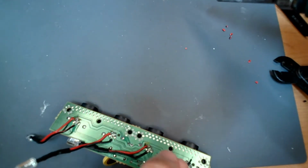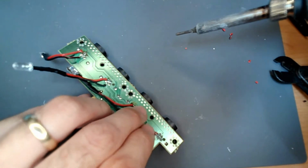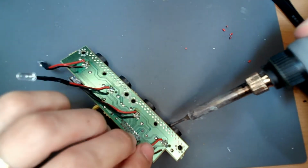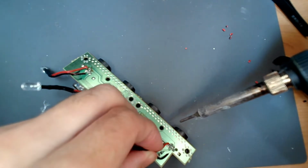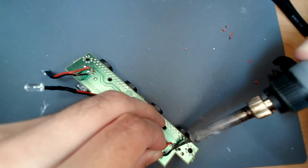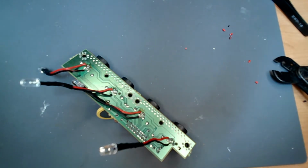Okay, I'm gonna pull this wire out a little bit. Hopefully you guys can still see this. Alright. Our wire where we want it. Down, and you have to make sure you're not pushing the wire with the soldering iron, otherwise when you let go it'll come up. Heat. Cool. And it's connected.